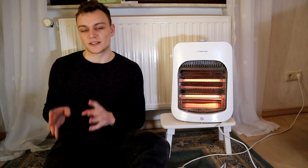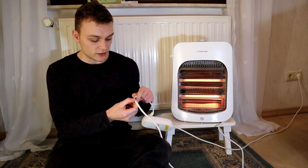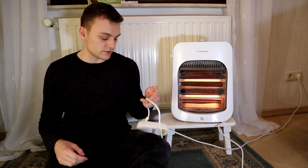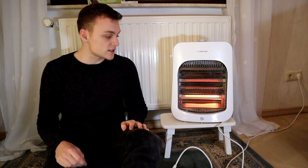As a conclusion: you shouldn't use an electric space heater with an extension cord. The risk of the cord catching fire is just too high and there have been many accidents. But in an emergency, when you absolutely have to use an extension cord, make sure it is a heavy duty one rated above 12.5 amps. Also, consider lowering the heat settings on your space heater — as you can see, when I lower the settings one of the heating sources turns off, so there's a smaller current flowing through the cable, which reduces the risk.